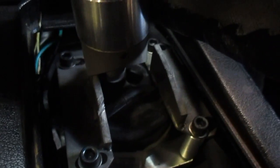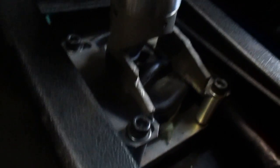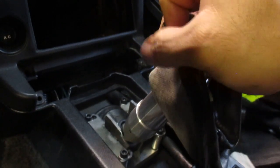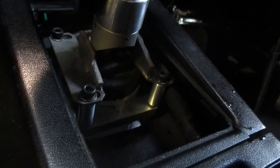What it does is it actually sits on the gate. When you shift from first to second in this mode, it goes into this groove here — and there's a slight angle that's angled up towards third gear. So all you do is just push the shifter into third, and this drops into the gate here. When it drops in, it's basically locked in, so there's no real side-to-side movement.